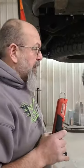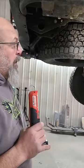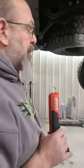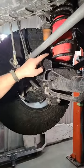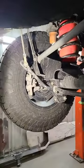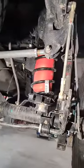This is a kit that will be on the website in the next week or month. We can build them — give us a call. So that's the rear. Factory track bar geometry on these is horrible. The factory track bar bolt is normally about there, but you can see it's way over there. So we designed a nine-inch longer track bar, kicked this bracket as far as I can push it. It changes the roll center and it drives night and day different. That's factory location there — that's the next one to get cut off, and the bolt will come out here to be evenly spaced from axle centerline.